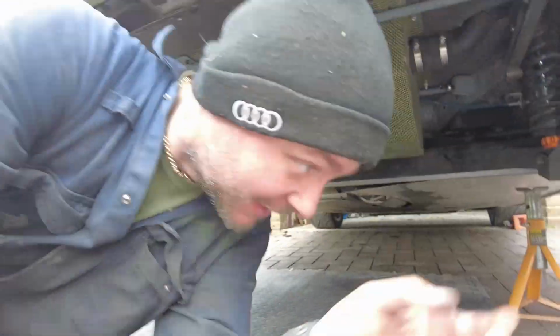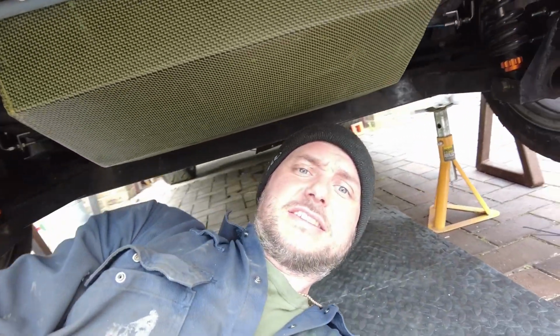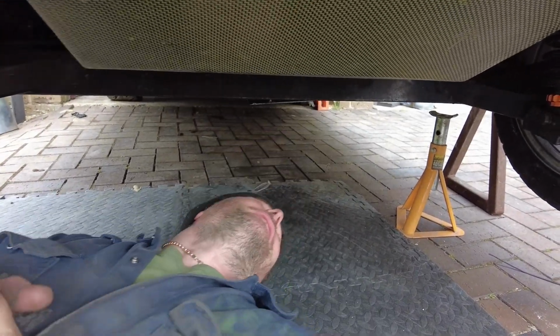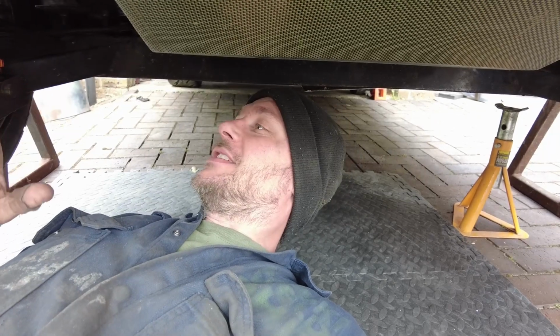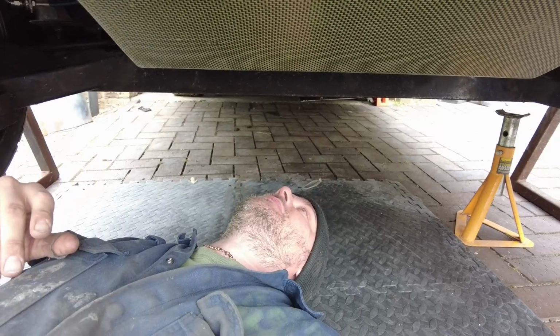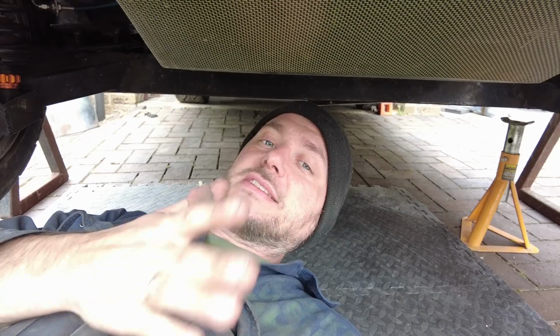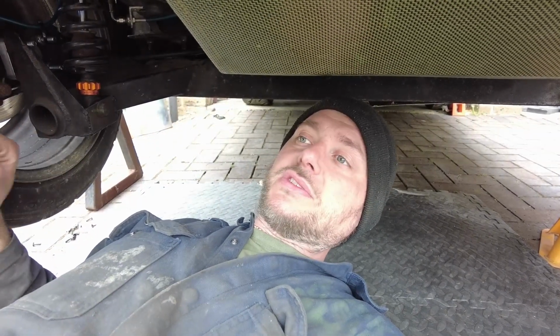Looks good. So the rear spacers are done. I'm happy to announce that we have a proper good track width and everything. As you can see, new slightly shorter bolts, everything is sorted, and I strongly hope that the suspension toe in and toe out is going to be the same. It's not, but I'm hoping it's going to be close enough. Reason being is that I hope on the lathe, when you take the 25mm off, it's going to be nice and straight, because obviously it spins anyways. So I've retained all the camber adjuster plates in the same position, so theoretically it should be very close. It would have changed, but you can't adjust anything on this, so the only way to adjust is to put more plates, and I don't think it would have changed this much. But anyways,